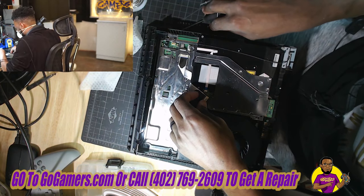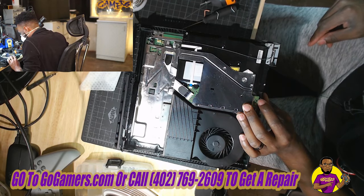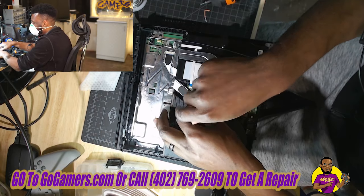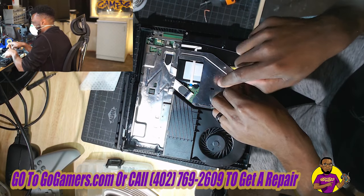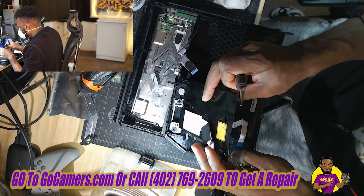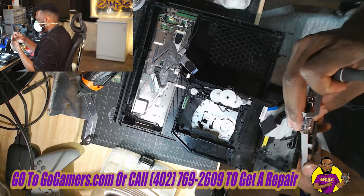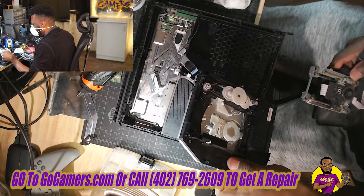Let's go ahead and see what kind of Blu-ray drive we've got. We have the 893-620-11 drive, which is similar to the B20 Blu-ray drives. Let's go ahead and pop off this back plate, get this laser out of here. We have a one-eye laser. I'll air-dust out this Blu-ray drive.